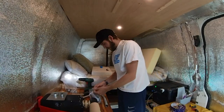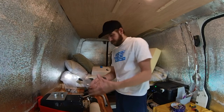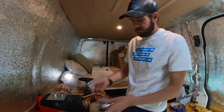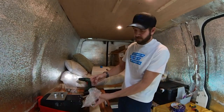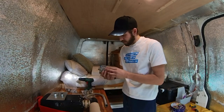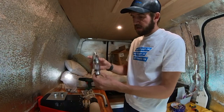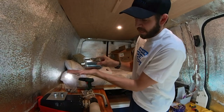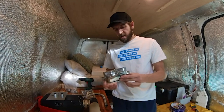So this comes with the silencer, and there's like a little kit in here to connect it all up, like a little bracket, so you can secure the bracket onto something, maybe on the subframe of the vehicle, etc. So it's really important this stays still. And there's also a good thing to note on this, there's a little hole on the bottom, so if you wanted to understand which way it goes, this needs to be flat. So when you mount it, don't mount it at an angle,